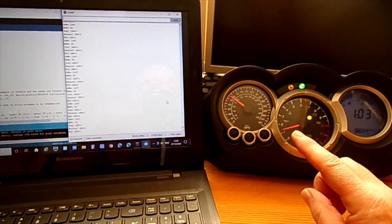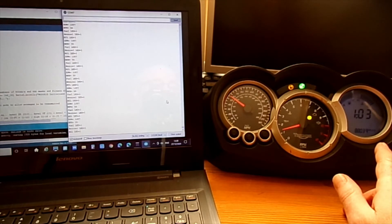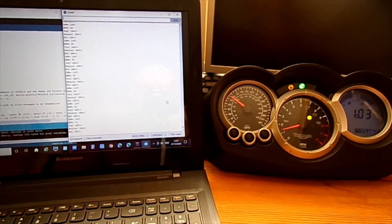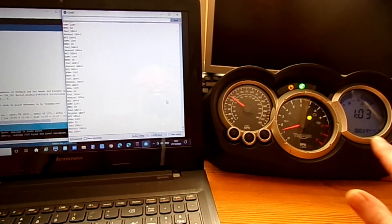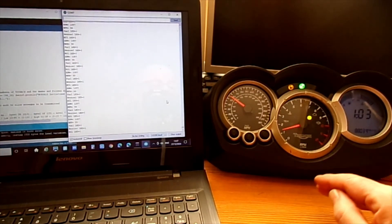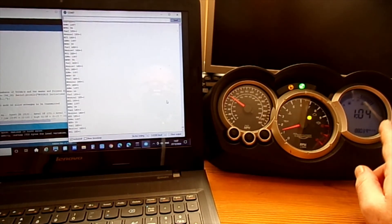I have run this for a little while before — it doesn't make any difference whatsoever to the odometer reading. Even if you set the trips, it doesn't do anything. So the only conclusion I can come to is the odometer reading must be updated from the ECU — the ECU gets a signal from the speedo and must just add up whatever onto the reading held on the ECU. It doesn't actually send that complete mileage reading to the clocks — it must just send plus one mile, plus one mile, and add it onto whatever reading is on the clocks.